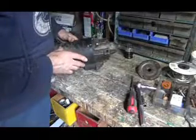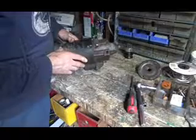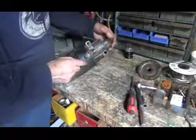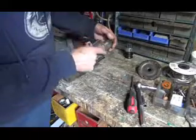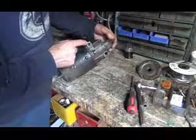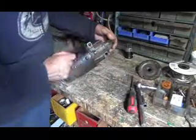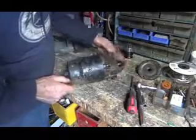even 90s. Chevys, pickups, cars, trucks. Some of the patterns were a little different. I noticed that in my car, the bolt pattern is straight across here instead of like this. And in my truck and van, they're like this. But basically, the rest of the starter is all the same. It's just the bolt pattern to bolt them up to the engine is a little different.